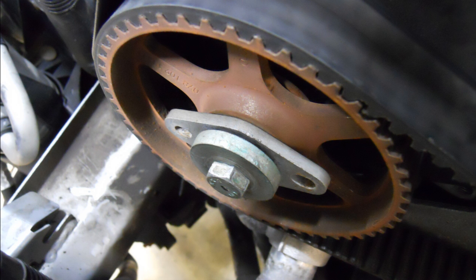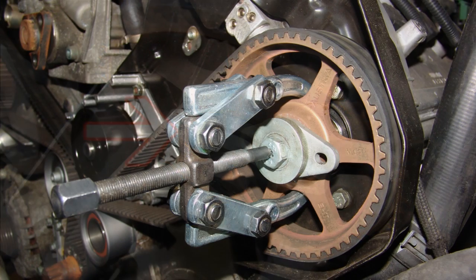If the timing belt tension is set without the tapered camshaft pulleys being loosened and reset, proper engine timing and timing belt tension will not be attained. By hand, loosen the camshaft pulley bolts about 3 to 4 turns. This will allow an air gap between the fastener washer and the diamond-shaped washer. You can now remove the cam lock bar tool 3391.